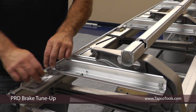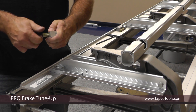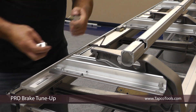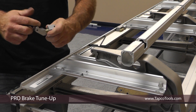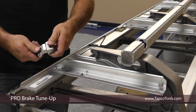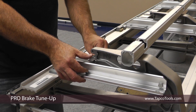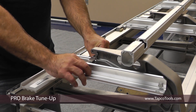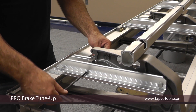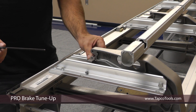Next, I will be installing the power links. Take the thread — the bottom block is a reverse thread, so you want to tighten that all the way down. Take your Allen wrench, get it a little snug. Then take the upper link — that's a standard thread pitch — bring it all the way down, leaving just about one thread apart. Take your bolt, line it up, slip the bolt through, lay it on the casting, and put the nut on the other side. Tighten it. You want to take your Allen wrench and your 7/16ths wrench and tighten the bolt just so it passes the nylock — just so you see the bolt protruding just past the nylock. That way it leaves this loose for movement.